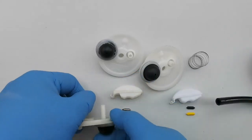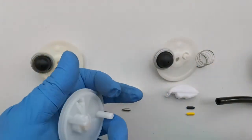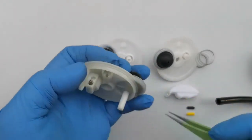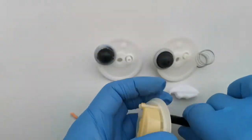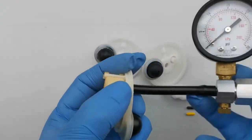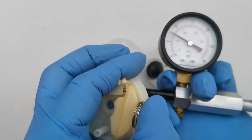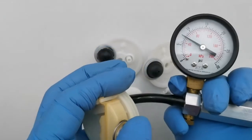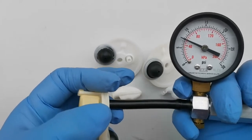Now let's try the difference when we use the metal needle. We'll use the genuine primer cup with our metal needle valve and the genuine float. Apply pressure here with the spring against the float and then pump. You can see that's holding pressure very well. That's the good thing with the metal needle with the Viton tip — it really seals the seat properly and stops the fuel from flooding, which is the most common problem with the old big two-stroke engines.